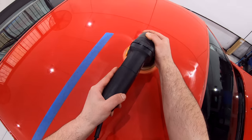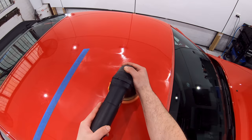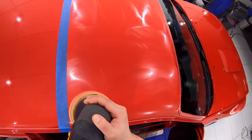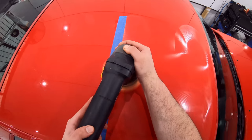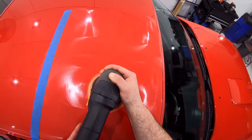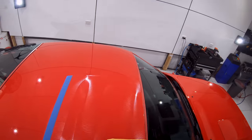Whereas plastics and many fiber-based materials tend to have more flex, which makes them harder to effectively transfer that cutting ability of your pad and compound to the surface, so it tends to be harder to remove defects. While their reduced ability to conduct and disperse heat also makes it more difficult to finish well, in many cases hazing up due to increased heat that continuously builds in one spot.